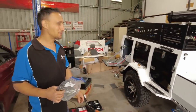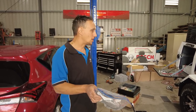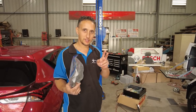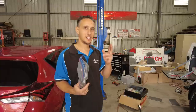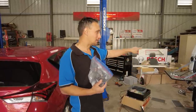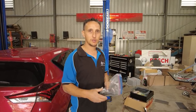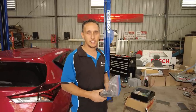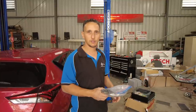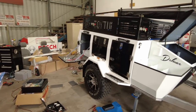The wiring was agricultural. Things I don't like are where they've put clamps and just self-tapped straight through the box tube where your main cable runs through. To me, that's a chafing issue — even if it's tube, it will still rub. So I've removed those so the cable doesn't rub through, particularly if you're driving on corrugated roads. It's a bit basic as far as I'm concerned.